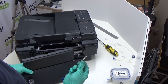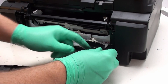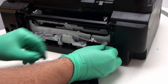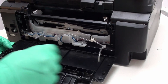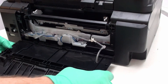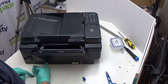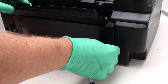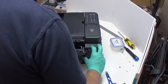Now that I have my hole, I get hold of my extension part and feed it into the hole I've just made. Then we can connect that to the elbow connection here — push that on, make sure it's good and tight. Pull a little bit of the slack out, and then as mentioned when we took the panel off, these little bits here match up with the teeth in the bottom. Just gently lift your panel up and over so that the teeth slide into those slots in the bottom of the panel, and the panel will hold on. Then just check down here to make sure there are no crimps or issues.